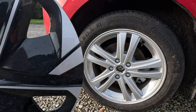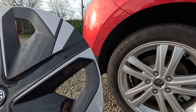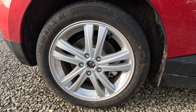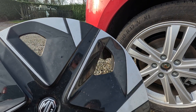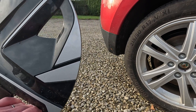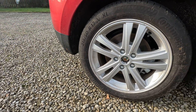So what is the benefit of this plastic disc? Well, these are designed for aerodynamics, and at lower speeds it won't make much difference. So if you really like the alloy look, you could probably drive around town with these off and never notice the difference. But if you're doing a long run, these wheel discs, which are pretty much flat, will actually save you around 5 to 10% range, depending on what speed you're driving at. That is why the cars come with these aero disc covers for the wheels, even when they've got lovely alloys like that underneath.